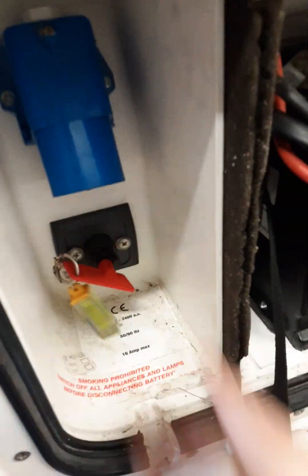Now going outside to demonstrate the motor mover fitted to the van. The caravan has a Truma Mover fitted. You get your bar and put it on the mover, then move it over to the wheel until it clunks into place and engages. This one engages both sides. Once connected to the wheel, you can release the handbrake, then turn on the red isolation key by pushing it in and turning it clockwise.